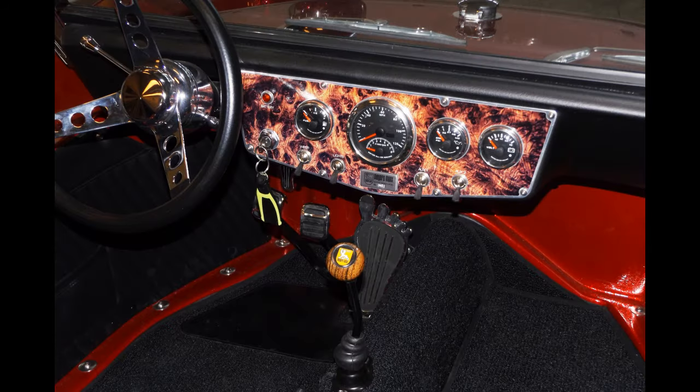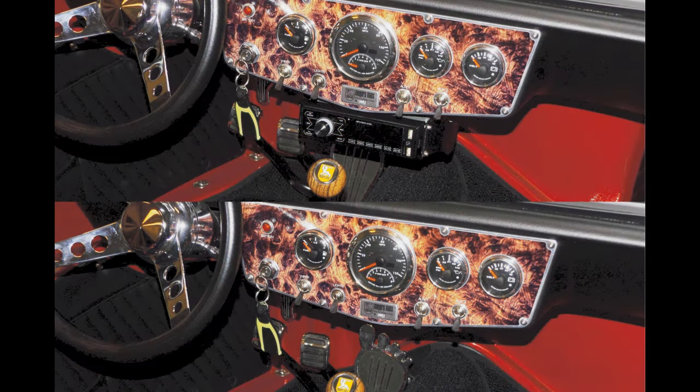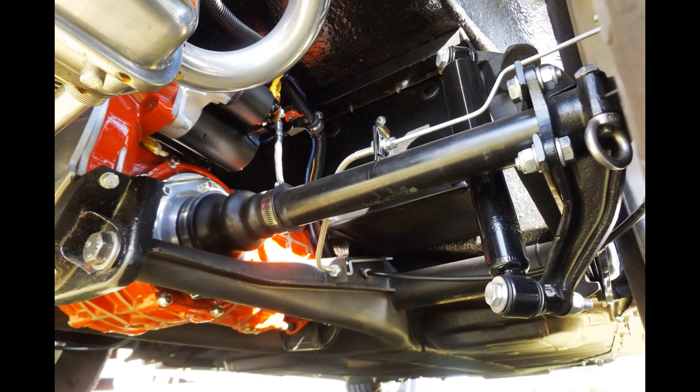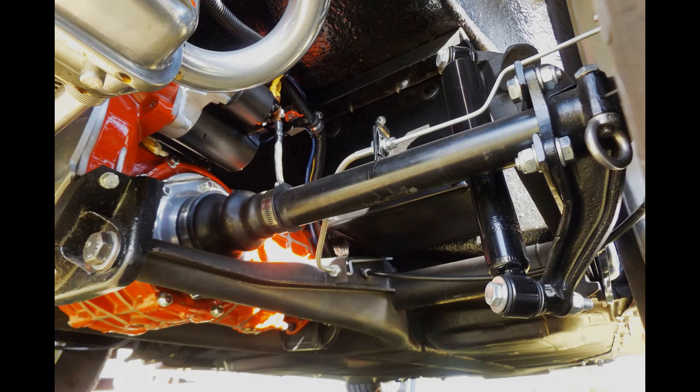Original black old-style paddle switches complement the polished aluminum and burl wood dash. While building the dash I wanted a radio but didn't like the idea of any modern looking parts on this car. The solution was to hide the speakers under the dash and make the radio fold up out of sight. A one inch conduit tube was installed through the center tunnel. This is where all wiring travels fore and aft, which both protects the wires and hides them, eliminating any unsightly wire nests common on many builds.